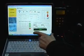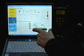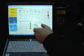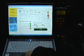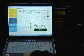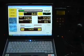This software is capable of self-learning a level gauge, but this isn't useful because some gauges give more resistance above 80% and then the gauge becomes inaccurate. We can stop this by ticking this little box here, which in Italian says manual configuration. Settings are now done. We'll go back to the engine page and now out on the road.